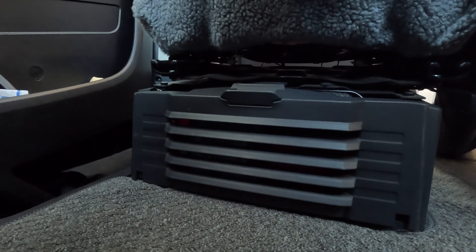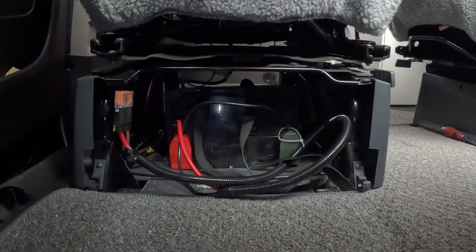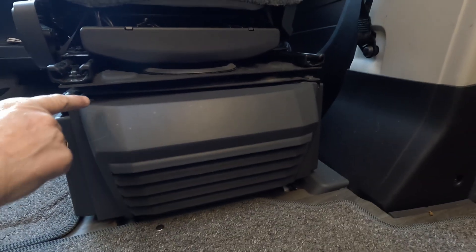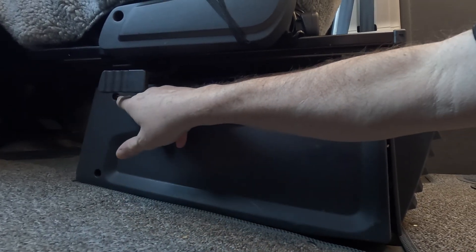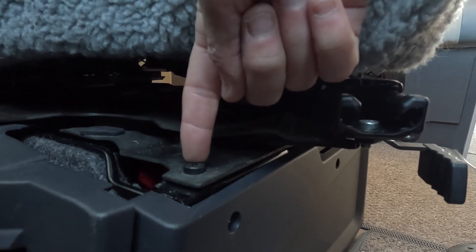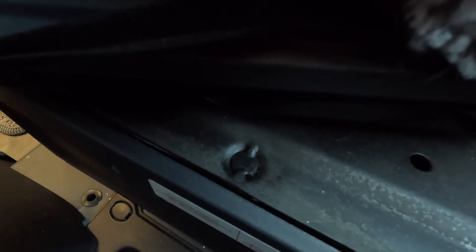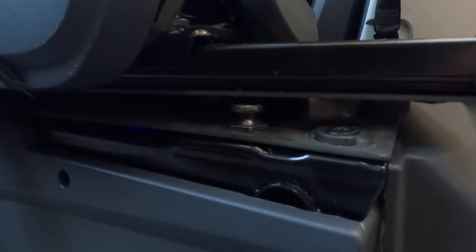Let's make a start by removing the driver's seat, as this is where the leisure battery lives on this vehicle. To remove the driver's seat, unclip the front flap — with that removed you can see the leisure battery. The rear cover is secured at the top by two plastic lugs; the two side covers are secured by three posi-drive screws. There are then five T40 Torx bolts — two at the front of the seat and three at the rear — plus two 13mm nuts on unwelded bolts and finally a 20mm headed bolt.